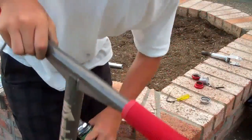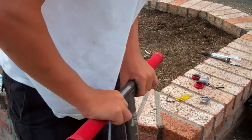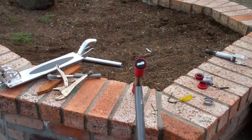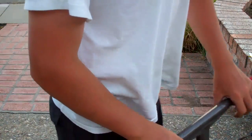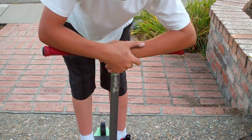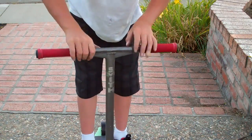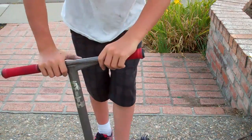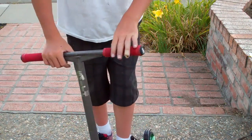And that's how you install a threadless headset on a threaded fork. That's all you have to do. If you have any questions or comments, just comment below and I'll be happy to answer. It's in there. If you have any comments or problems putting in cups or anything, I'll make a separate video of me doing the cups and putting them in. Thanks for watching, hope it helped.